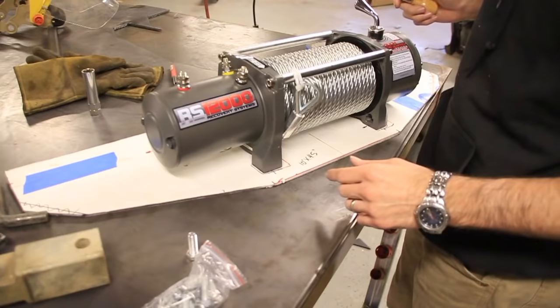Since they're not both exactly the same size, I'll take them and put them together before I grind them — that way they will be. Once both edges start to grind, you know that they're both the same and I just need to grind the extra off the edge of that one. Now here's what I want to do: I want that to sit in the front of the bumper in that little round piece, so I'm going to bevel that with the angle grinder. I've clamped them both together so I can do it in one swoop.